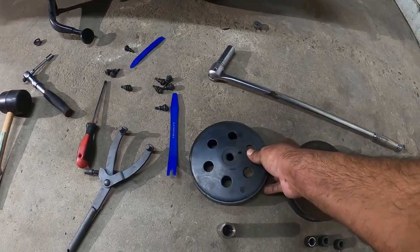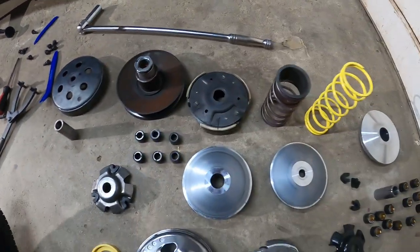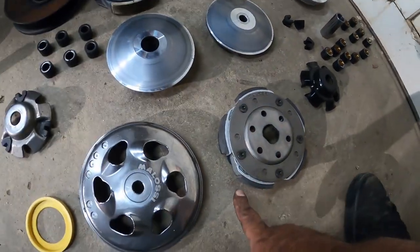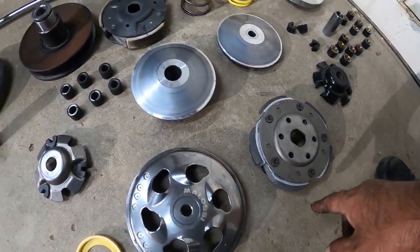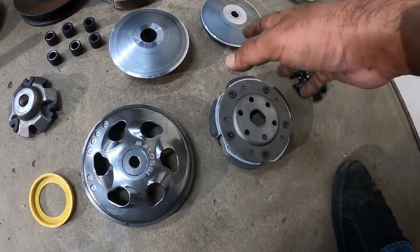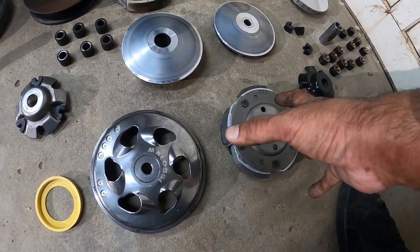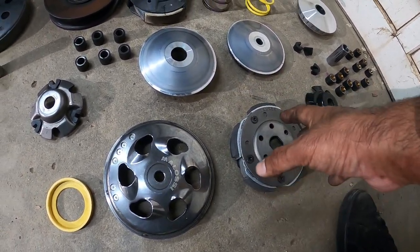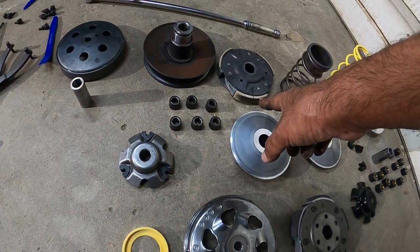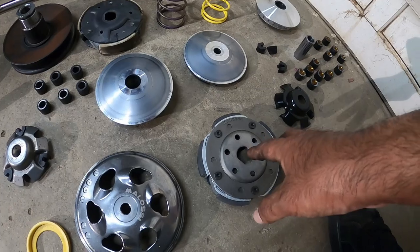It's just a little basic bell housing, nothing special, just so the clutch can grab onto it. And you'll see, again, six pads of material here versus three big ones. These, again, provide more gripping surface, and since there's six pads, you have less chance of glazing over one gigantic pad like this guy. A little bit better even wear over time as well on this style of clutch.